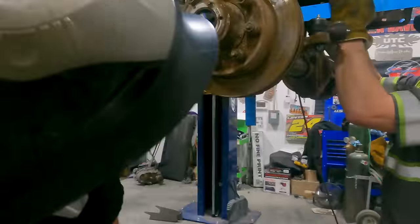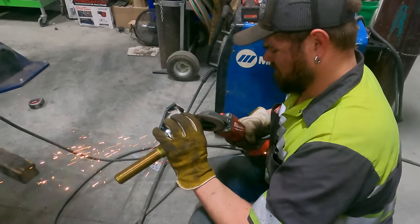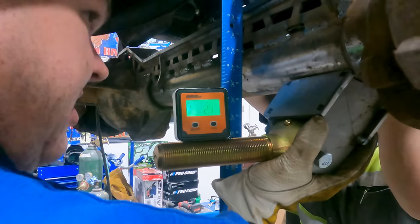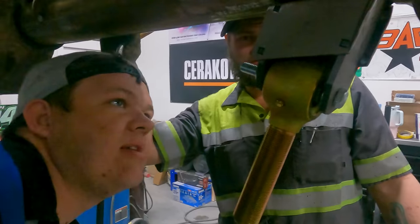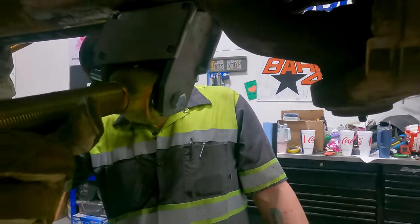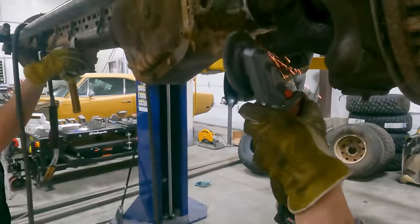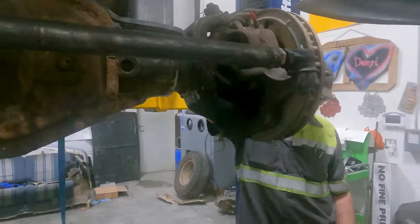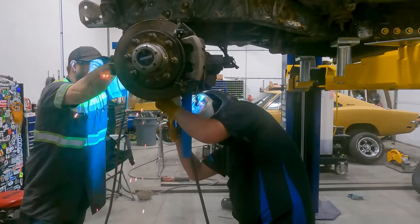We're ready to achieve our 10 inches of separation. We need to grind those off the tips. We're gonna go as far out as we can — that's gonna give us 10 inches of separation right there, exactly 10. So that's 83.7 degrees. We're above the pinion so it's not a low point — we're gonna hit the ball joint before we hit that. We're definitely gonna have to notch that out before we weld it in. We're just gonna get this set in place, tack it on, and take it to weld town.